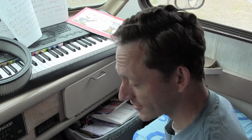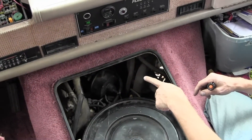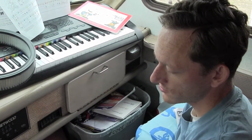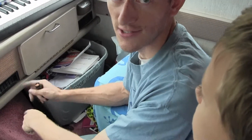I think I'm going to be able to replace just that wire from where it Y's off. I've got to find the right length of cable, get the right gauge of wire, splice the new wire to the old one, and pull the old one out — as it pulls out, the new one will thread down through that housing so I can connect it to the engine. I'm also going to need to test the solenoid and pull the starter out, because the starter might have gone bad — and we replaced it less than two months ago.